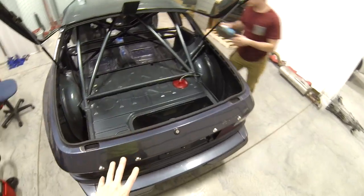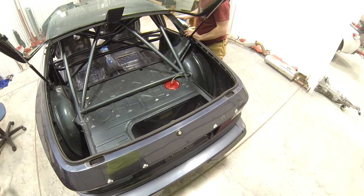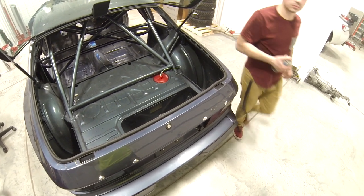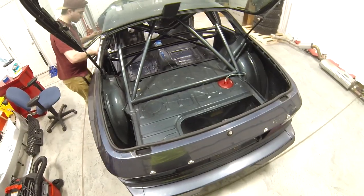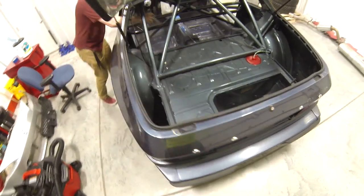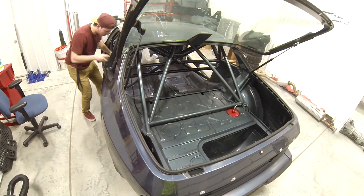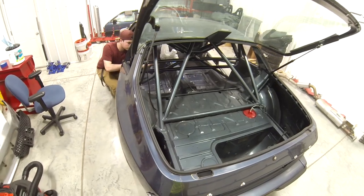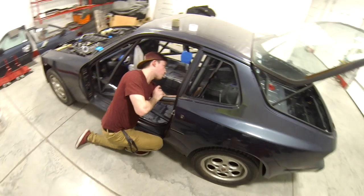The rest of the cage isn't clear coated. It was just a single stage, like single stage auto paint. So I think it's already got UV protection somewhat. It was legit single stage paint. Single stage can chalk out, but what's crazy about it is you can actually buff most of the chalking out of it.